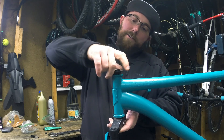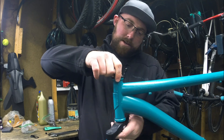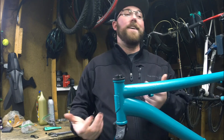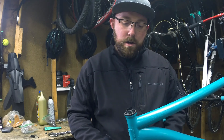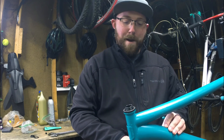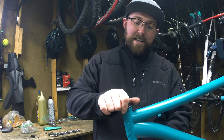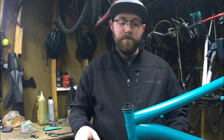There were a couple little burrs in there — no big deal. So screwing that down: this race on top is going to control the tension on your bearings. You want to make sure it's nice and solid so there's no rattling while you're riding, but not so tight that you can't steer at all. Tip the stand down a little bit — you shouldn't be able to move the fork back and forth loose like that. And if you over-tighten it, you'll see that when you turn your fork it just stops and won't move. You need to find the sweet spot right in the middle — where you turn the bars and they return to center.